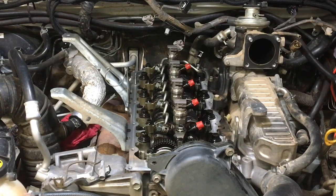So we're halfway through the job now and I just want to give you the update, and I'll do a bit of an update a bit later on in the video, so stick around. Now this is what we've found so far. Removing the torque on the pipes, they certainly didn't use a torque wrench. No surprise there. Some of them really tight, some of them a bit looser. This is the issue. The risk is, and I didn't fully go into it in the other video because it just makes me want to almost cry, the waste, it's just such a mess now, right? So the old fuel pipes, the risk is they could leak, okay? So new pipes, new injectors, new pipes, right?